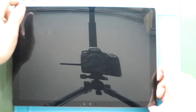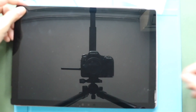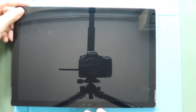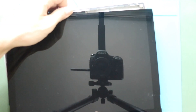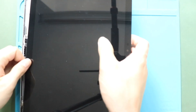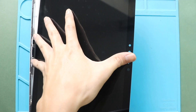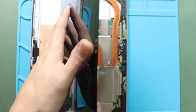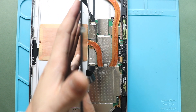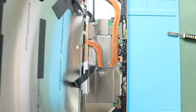Be gentle while pulling. Next, flip the screen to about 90 degrees and then disconnect the LCD video and touchscreen connector plugs. First, take out both protector shields covering the connector plugs. Gently use a pry tool or tweezer for this process.